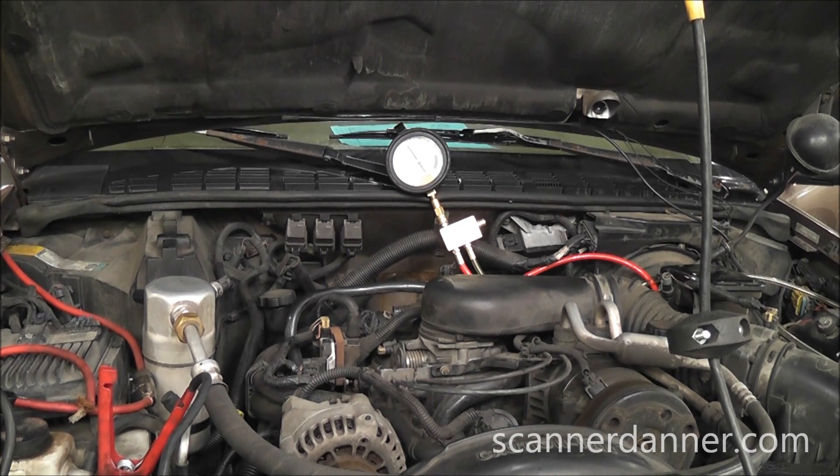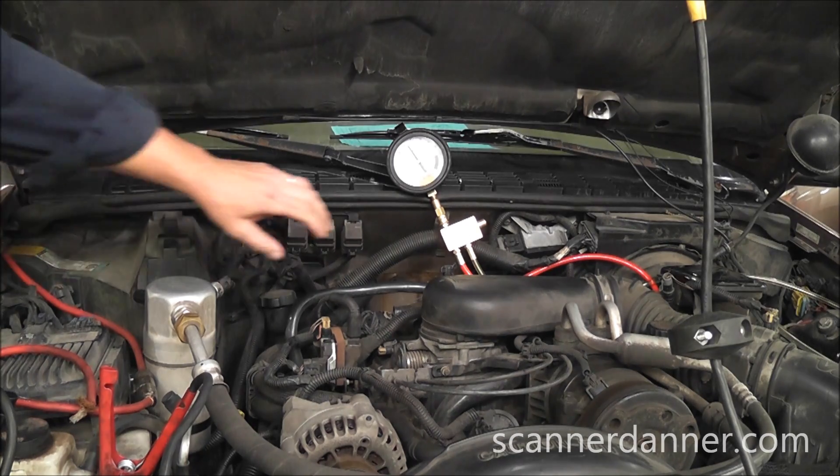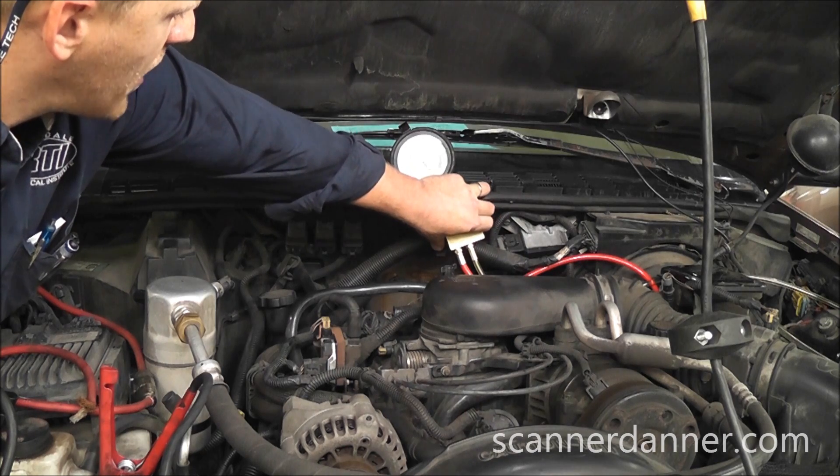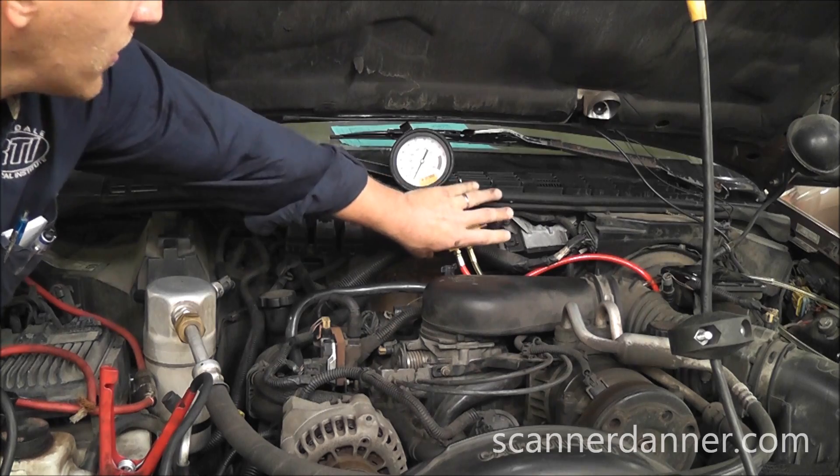To justify what we just saw — if you think about cranking voltage, especially on a weak battery, you're talking 9 to 10 volts cranking going back to that fuel pump as opposed to 14 to 14.5 volts with the engine running. So we put propane in the intake, that's enough for the engine to run on propane, then charging voltage rises and that allows the pump with that higher voltage to produce the pressure that's needed. If I bleed this out, I'm probably going to recreate this no start condition.